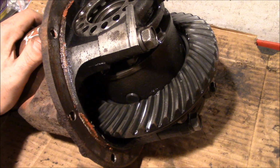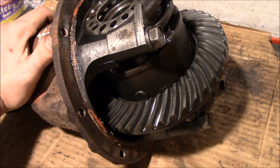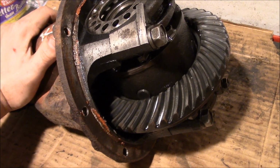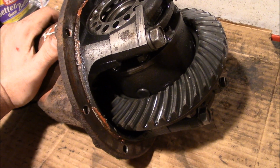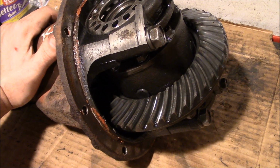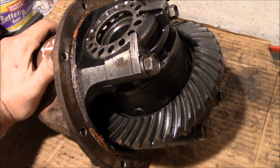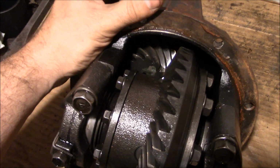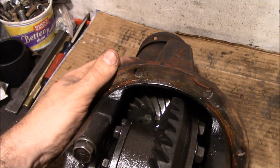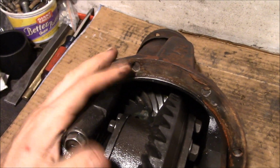And it goes for regular new sets of gears that you're putting in as well. You gotta have patience and be willing to take things apart again and again and again to actually get to a result that you're happy with. If you give up or you say, it's close enough, that's what's going to end up biting you. So you might as well just accept the fact that you're going to have this pinion in and out of here a dozen times, resetting shims, setting the backlash again and again.